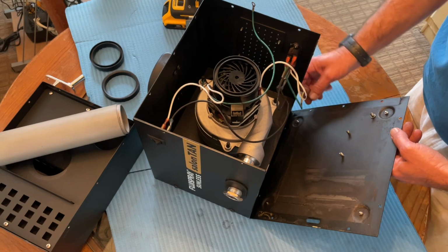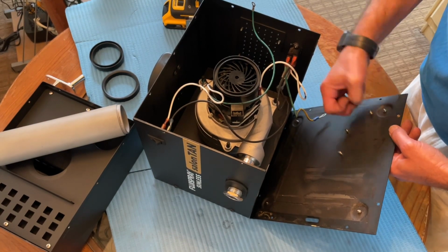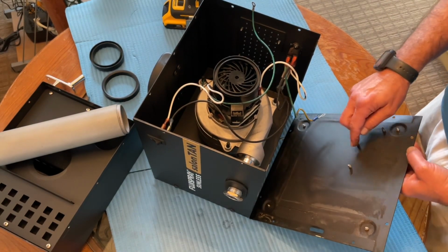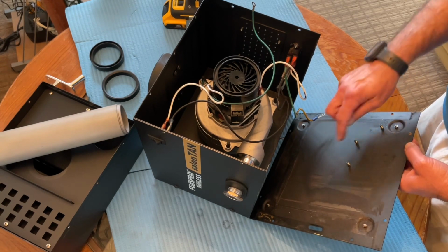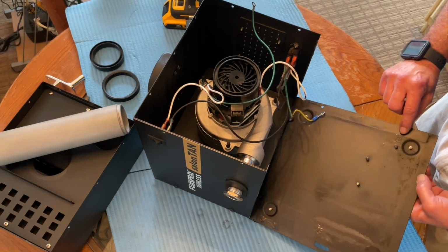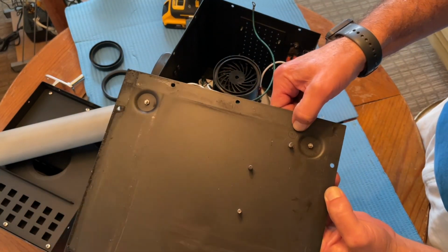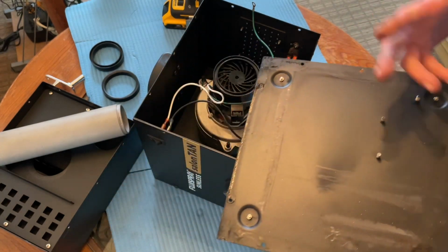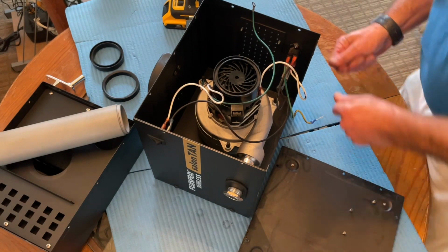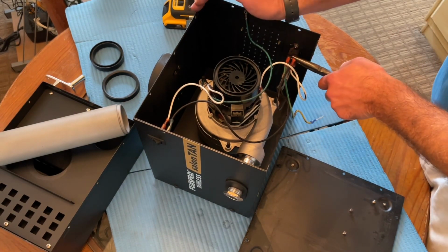Underneath this bottom ground is a washer that we'll have to take off to clean the floor here. You also notice there are actually 3 threaded pins here. The one that we use for the ground is actually marked with a symbol. I'm not sure you can see that under all the dust, but there's a ground symbol there. As you're taking photos, you can make sure you get it back in the right place. And we'll want to disconnect all the wires.